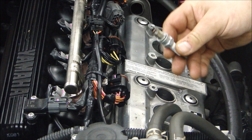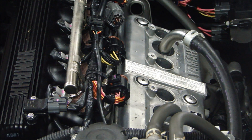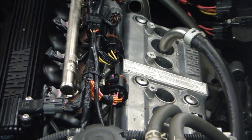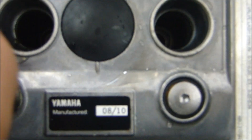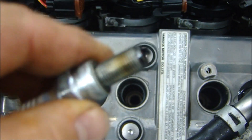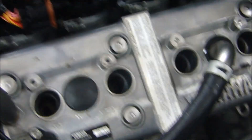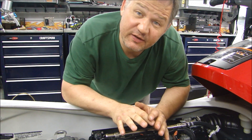Okay, I have all my plugs out. Looking at them, there's a lot of water and moisture on the tips of the plugs. I'll turn it over real quick — and as I suspected, there's a lot of water in there. Looking down inside the bore, you can see all this water that's been spit out of the cylinders. There's water inside all the cylinders and it looks even across all of them — all the spark plugs were fouled very similarly with water and moisture. I'll take the head off and see what it looks like.